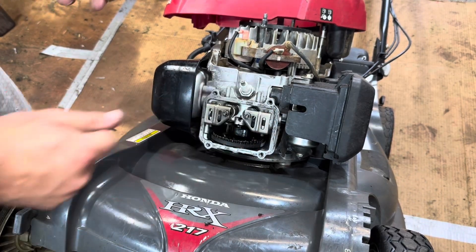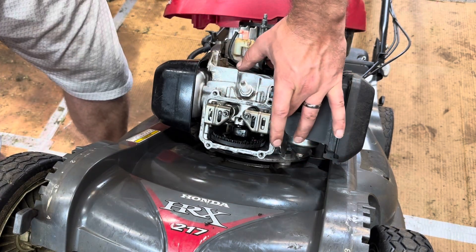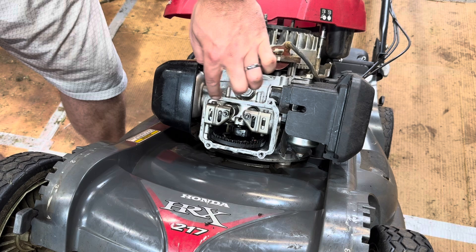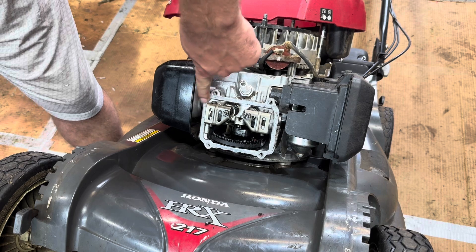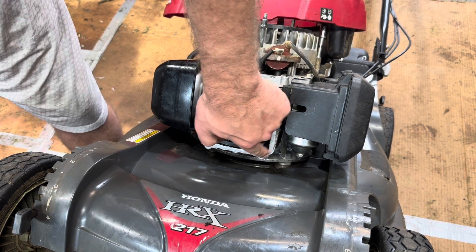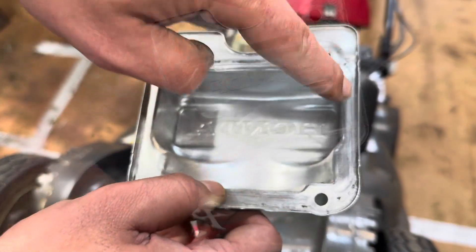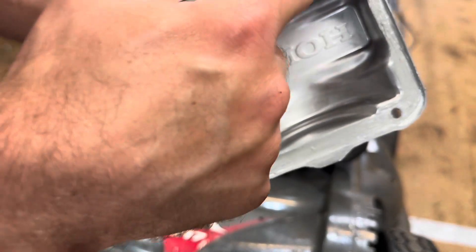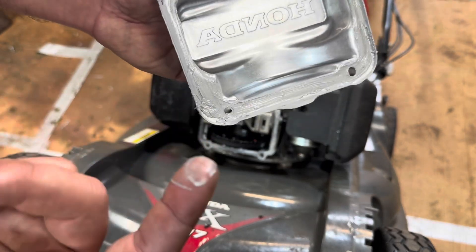Make sure you get all surfaces clean with some brake cleaner — you don't want any oil residue on there. I'm giving this a little bit of a back coating so it mates to the cover. It's okay if you get it down the bolt holes a little bit; the bolts aren't going to stick. I'm going to do the same to the mating surface — fill in these little ridges, make sure you've got at least a thin layer over the entire surface. Doesn't have to be a lot, and it's okay if it goes just over the edge a little.